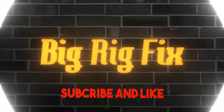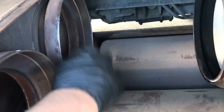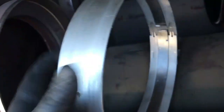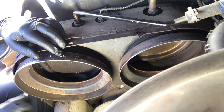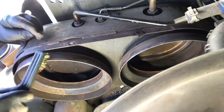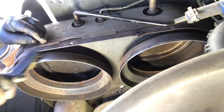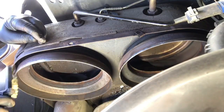All right guys, let's get to it. You've got to make sure you clean this gasket off. You can see right here — this new clamp has a gasket that's glued inside of it, so you've got to buy new clamps. But you've also got to clean the old gasket material off. I use a small screwdriver; it works really well — just go along the surface. It takes a little bit of time but make sure it's nice and clean.